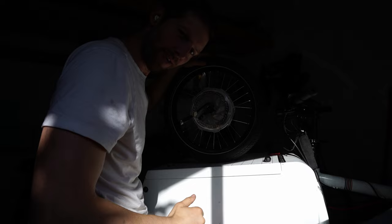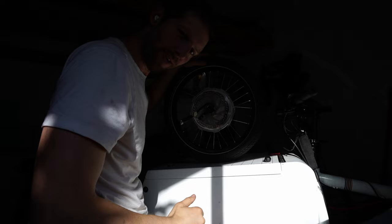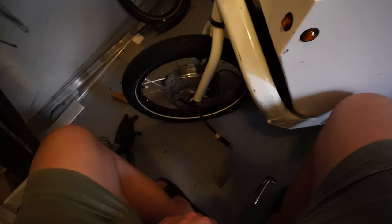As you can see, problem solved — you just got to grind that puppy down. I've got the torque arm installed. I just had to briefly readjust the brake caliper and now it's running real smooth. Look at that dual motor. This thing is no longer a slog — it's now a proper hog.